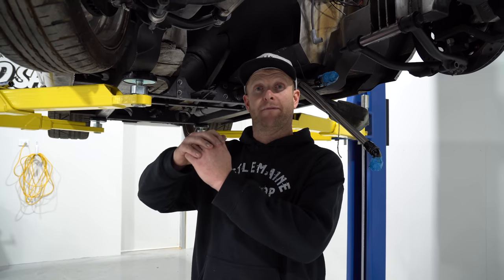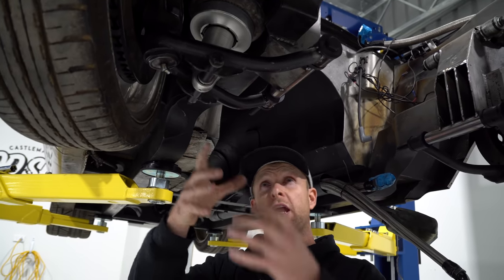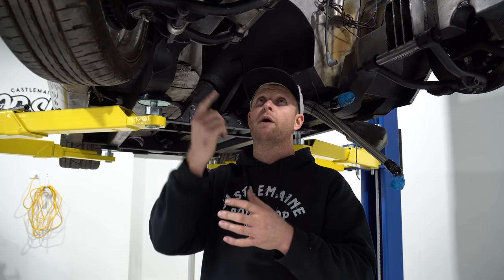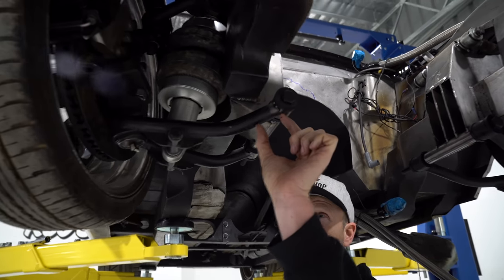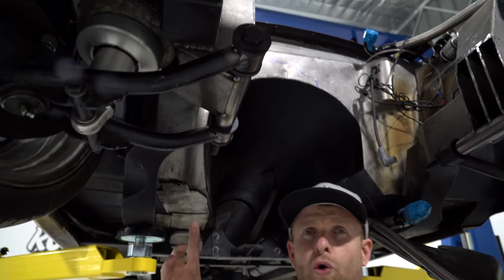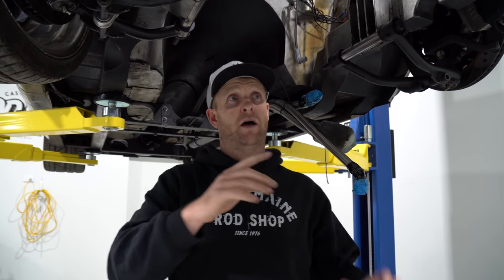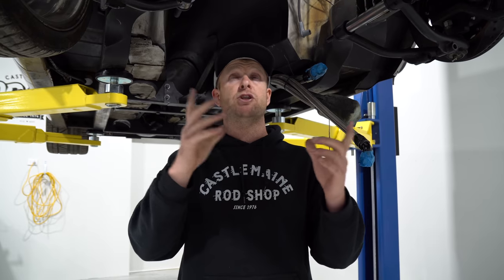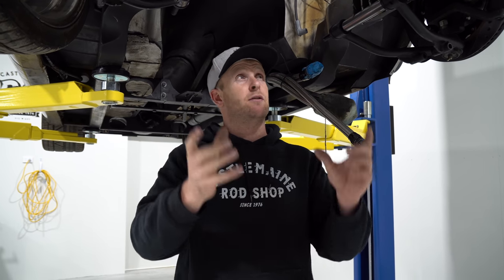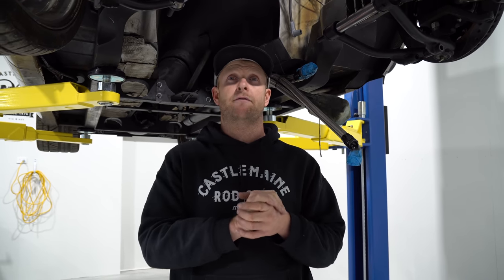We're back up in the air - this is with full air in the bags and clearance is really good. In the spring pocket where the coilover was, the airbag is sitting there with nice clearance - probably 10 to 15mm all the way around fully pumped up, which is good. The modification has been taken out of the arm and it's tacked up, so I'm pretty happy. Next we'll do the other side, then try to get that engine back in, get some engine mounts sorted, make sure the dry sump clears, and get that rack in position somewhere too.